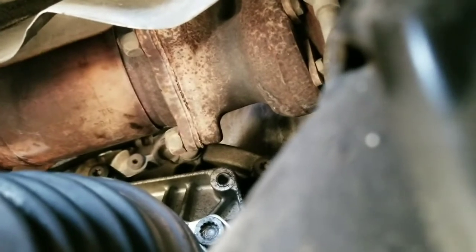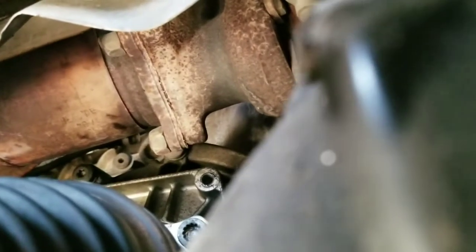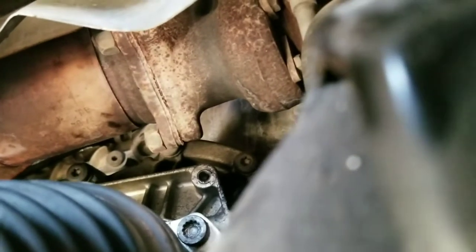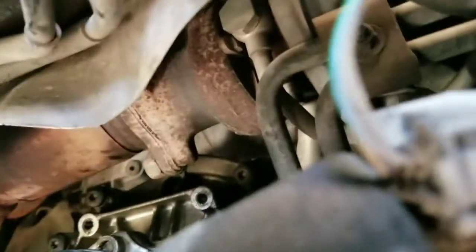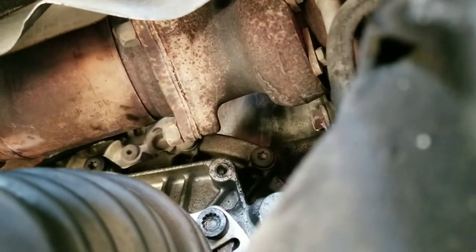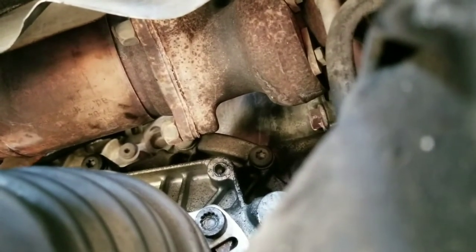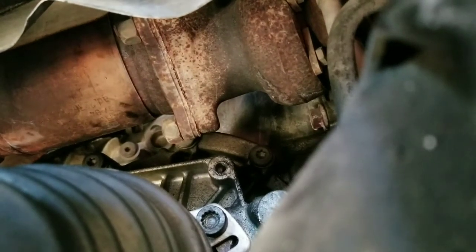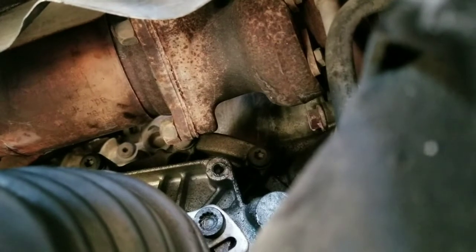I'm going to go ahead and use a ratcheting wrench if possible, if not an open-end socket, to get those guys out. Now those are the easy ones. The top ones are the real pain in the ass ones. The other side, on the driver's side, I had to use a long extension with a swivel bit. For the top one, for the one that went off center, I had to use 2 swivel bits.